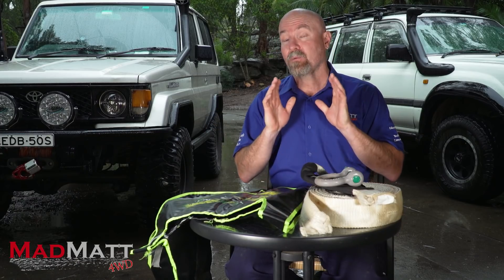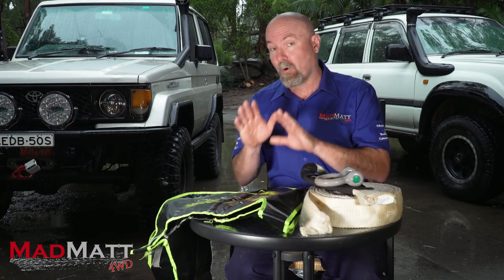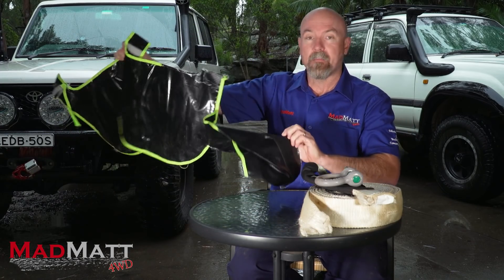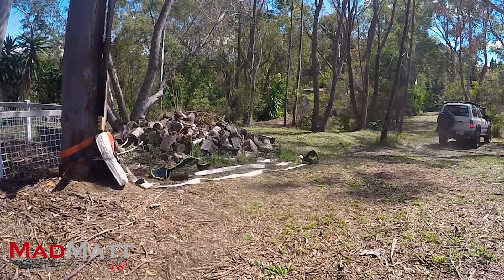After filming that, I was on a TV show called the Off-Road Adventure Show and we went up Cape York. We were doing a very serious recovery scenario with snatch blocks, double line winch pulls, and we were lowering a vehicle over a very steep escarpment called Gunshot. Halfway through, the snatch block failed. Prior to setting it up, I said to the team we need to make sure we put five kilos of weight into each of the air dampers. When that snatch block broke, the air dampers did their job and they all ended up destroyed. I'd rather destroy an air damper and save a vehicle or save someone's life. So I'm absolutely convinced that we need to use three air dampers with five kilos of weight on any sort of snatch or winch line recovery.